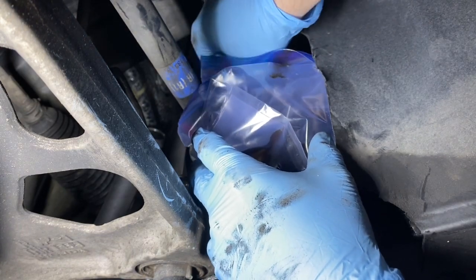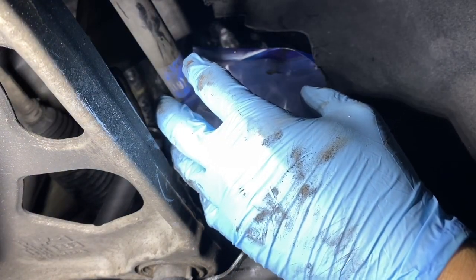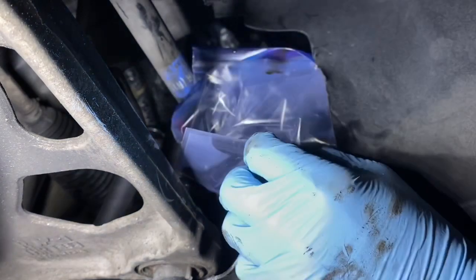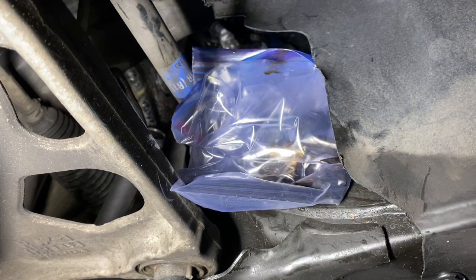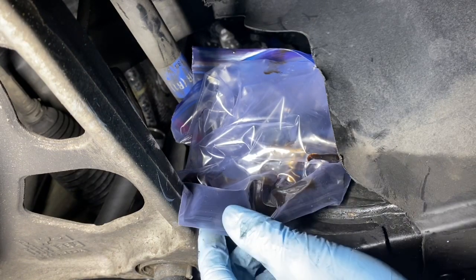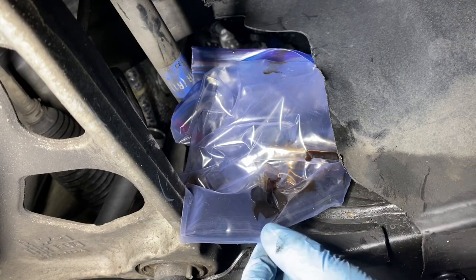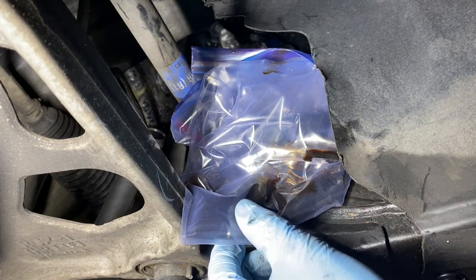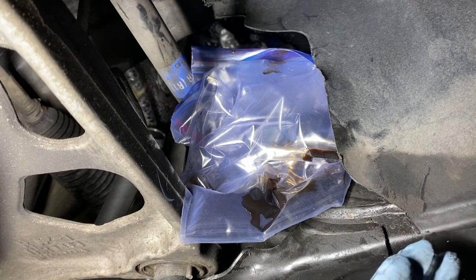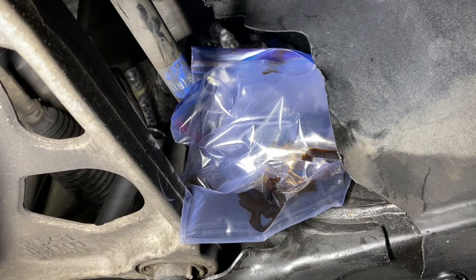After the oil stops dripping from the oil filter assembly, I'm just going to remove the bag and wipe it up. As you can see, this bag catches all of the oil. And because it's double bagged, I don't have to worry about spilling. I've done it with a single bag and it actually leaked through. So double bag it to make it a little more sturdy. It makes for easy disposal — no messes. I don't even have to have the oil catch can underneath here because there's no oil going to drip out.